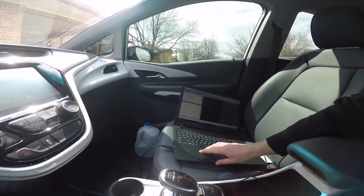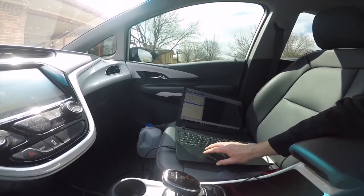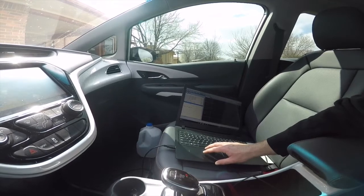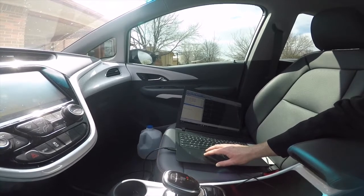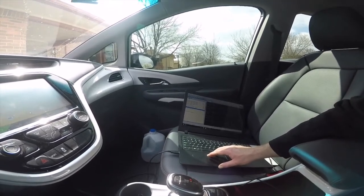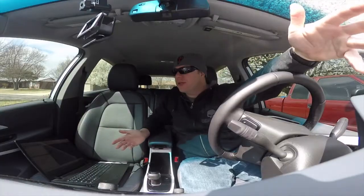I've got several that don't have anything to do with this because it was loaded for the Sky originally, but let's see what this says. Fuel type: electric. I press the pedal — obviously it's in park. All the control module voltages are normal. Hybrid battery is at 84.3%, and since I have hilltop reserve off, that's going to end up getting to 100%.